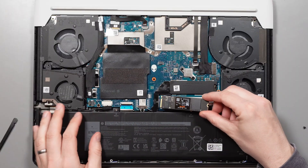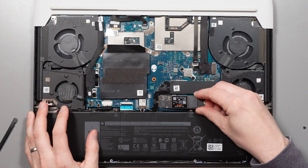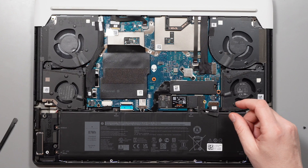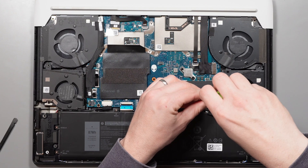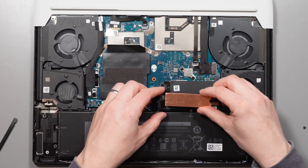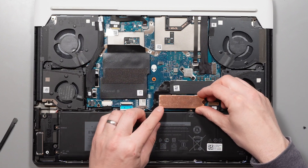Installing this in your laptop or desktop is incredibly easy — these M.2 drives are so easy to fit. If there's a screw already in place in the drive slot, make sure you take that out first. You slide your drive into the M.2 slot, screw it down, and then screw your heatsink over the top. Or in my laptop's case, I stick the heatsink on the top.